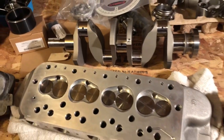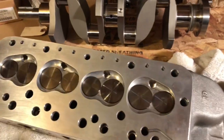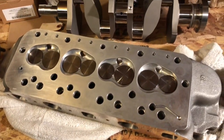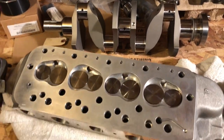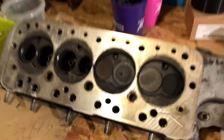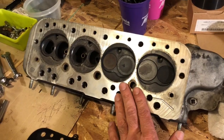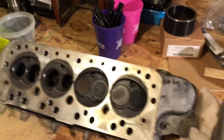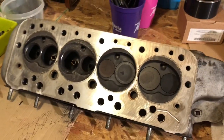We had a bunch of performance heads from different people, and this thing on the intake side outflowed everything right out of the box — pretty impressive. There are some subtle improvements over these Pierce heads, which have been available for maybe 25 to 30 years. I really like them — our own Cooper S has one with big valves installed.